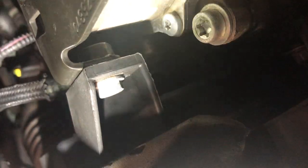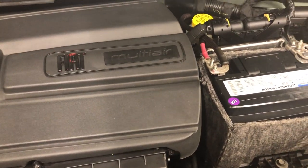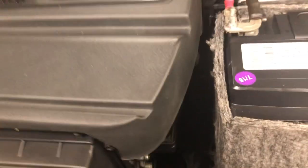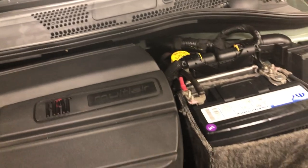Back above it there is a PCV assembly. There's the top of it right there — it's a breather assembly and those can possibly leak. A little bit of oil on the seal can bleed through and get to the number four cylinder by dripping down along the side of the engine. That's a wear item that eventually might need to be replaced — they're about $60 to buy the whole assembly.